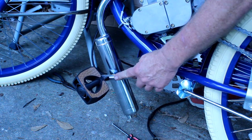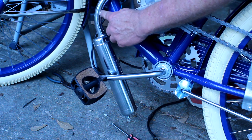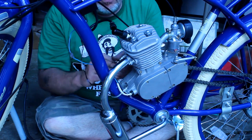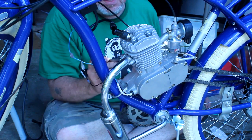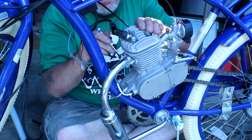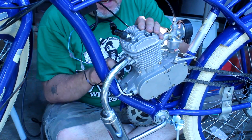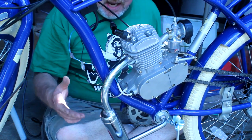I have plenty of clearance between the muffler and the pedal crank. If they strike, you may have to get a torch, heat the exhaust, and bend it in a little bit. We're in good shape, so let's tighten it up. Tighten both sides slowly together — you don't want one side real tight with the other loose, as that may cause issues. Give each side about a half turn, then about another third of a turn. It's fairly tight — you don't want to over-tighten it or you may strip it.